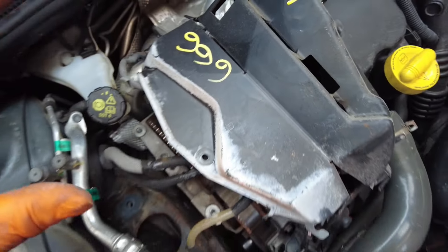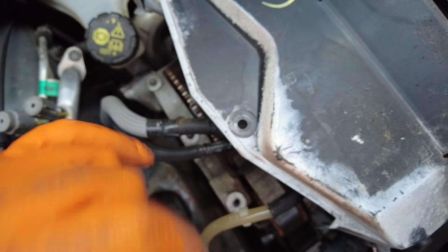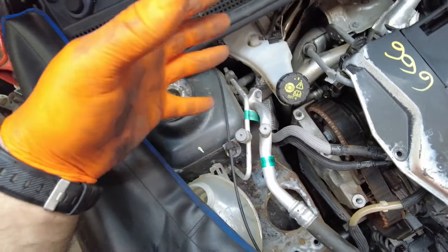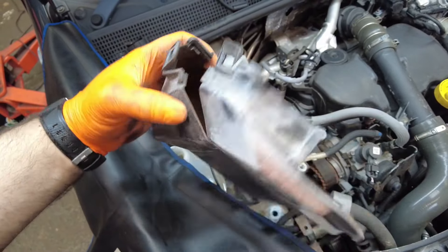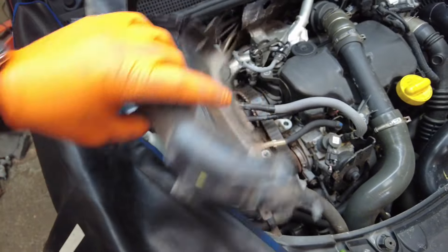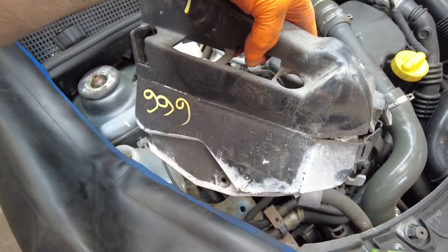To remove the timing cover, there is a little black press in the cover that you have to prise out — be careful with it because it can pop off and go into the chassis leg or anywhere. The timing cover itself is fairly simple to remove: there are some little wing clips and you can just pull it out. There is a little bit of a fiddle where you've got to jiggle it, but yeah, that is now out.